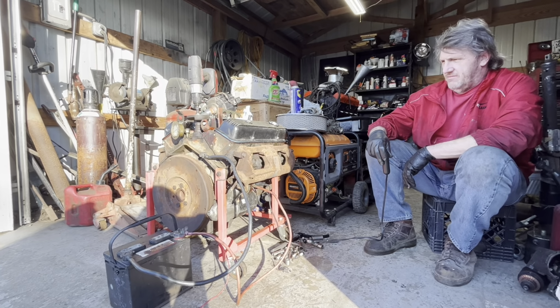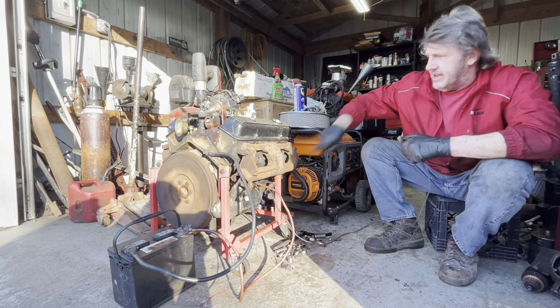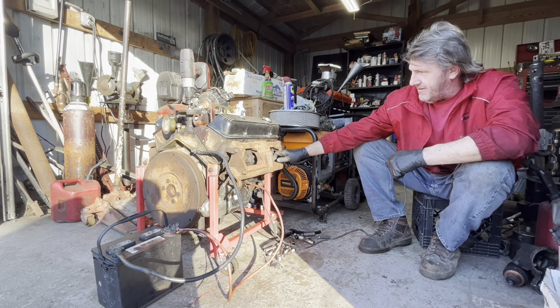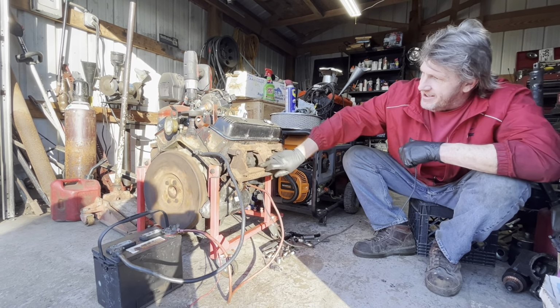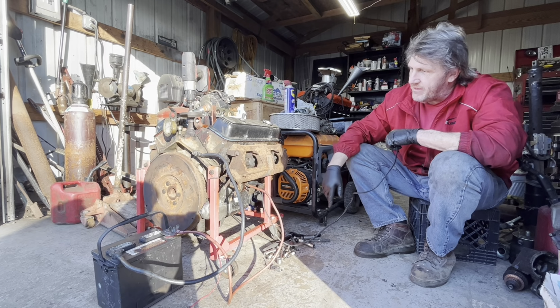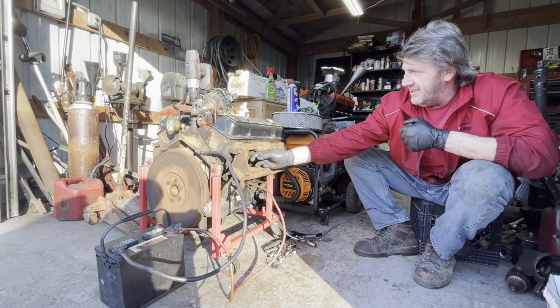Oh, dang. That thing's blowing me from over here. Sheesh. All right, I didn't mean to squeal like a little girl, but that's a lot more compression than I thought. Dang. And we got one that has nothing. So 3 out of 4 ain't bad. We'll get that one freed up. More likely a stuck valve. Let's do it again.